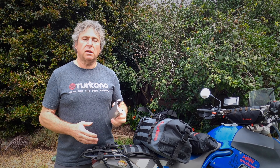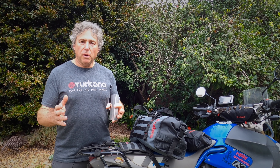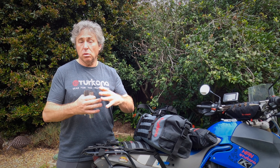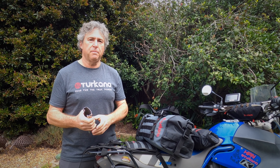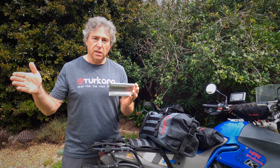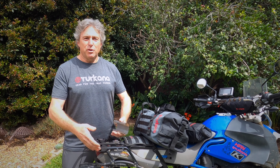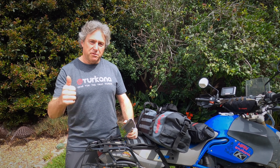Lastly, very important — we do have a heat shield. Many motorcycles do not need a heat shield, but there are motorcycles that will. We recommend that you keep the bags five to seven centimetres away from the exhaust, or at least have some airflow between the bag and the exhaust. We have a 15-centimetre and a 25-centimetre long heat shield available. That's it folks — that's all for the MadMules. It's quick and easy, there's nothing complicated about it. Go have fun — you don't need to like or subscribe, just get out and ride. Cheers.